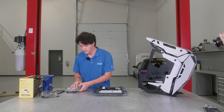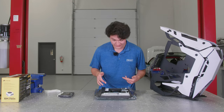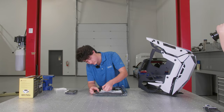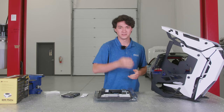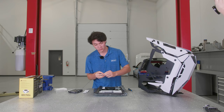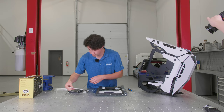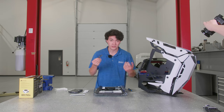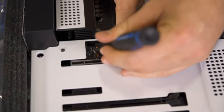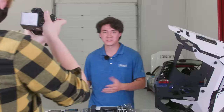That looks really nice. So we're going to go with our Samsung SSD. I've never dealt with this motherboard before, so we're going to have to take off these shrouds — but it says lift here to remove. You're going to grab a tiny little screwdriver for these tiny M.2 screws, notorious for getting lost because they are very, very minuscule. This board comes with two SSD ports, so if you ever want to expand in the future, you've got two ports. Magnetic screwdrivers help a lot — pro tip. And that's in nicely, never to be seen again.